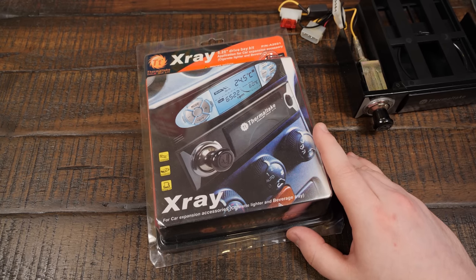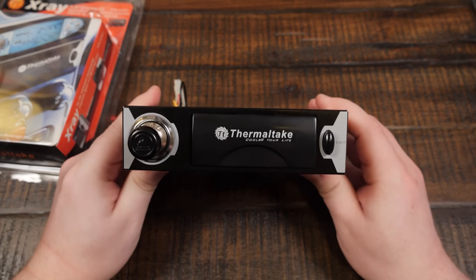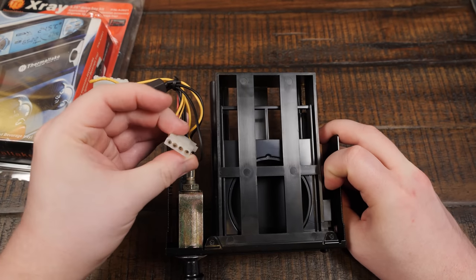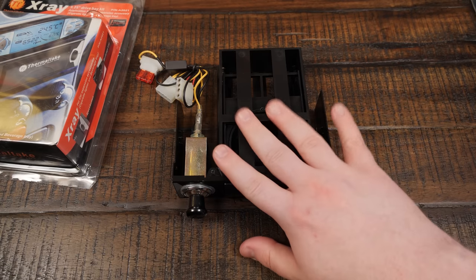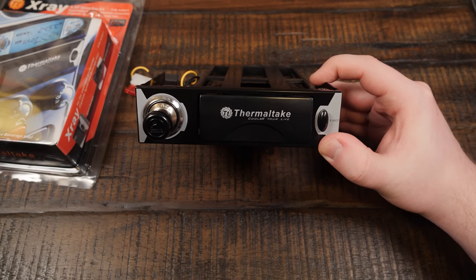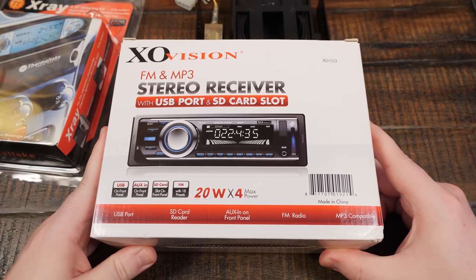It wasn't made up — it really is for PCs. It's just made to look like something that would go in a car and happens to have some very badly translated stuff. This is a 5¼-inch wide device, so it fits in a 5¼-inch drive bay. It's got four-pin Molex connectors for connecting to a PC power supply. Some people were saying that it's the same height and width as a car stereo, so you could fit it in there anyway. But no — this is something I picked up at Goodwill just to prove this point, just some cheapo stereo receiver.